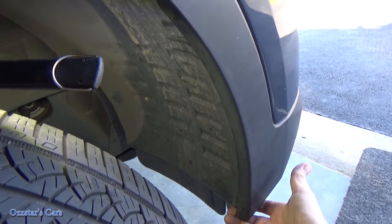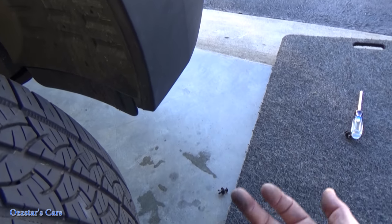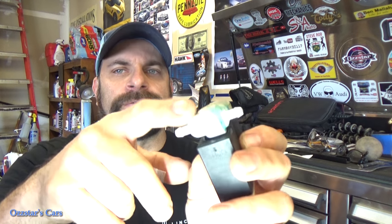Pull out on the bottom of the bumper cover and work the liner back in from the bottom up. Put your two clips in and you should be good to go. That diagnosis was pretty easy and the repair was pretty simple. It would be nice if you could just get that cracked part — it's probably a dime — but unfortunately I couldn't find it. I tried crazy gluing and plastic glue; it doesn't work. Just replace it. We found out the replacement rubber grommet was a little small for the 2013 Santa Fe, so don't use that one. Maybe it fits other Hyundai models. They call it a grommet washer pump — anyway, the OEM is fine and we're all set.